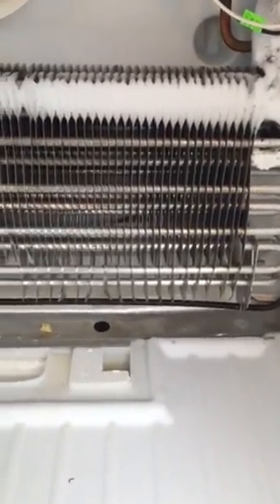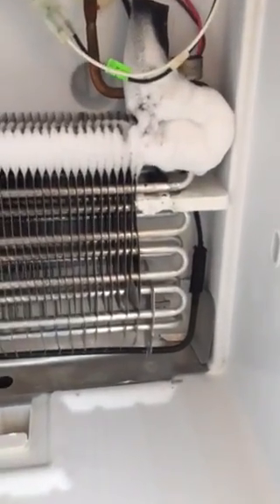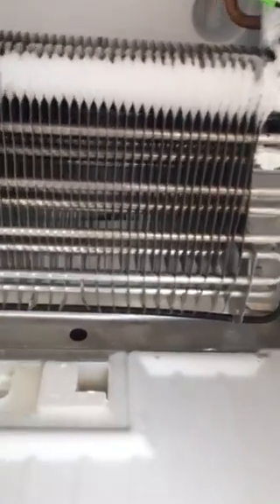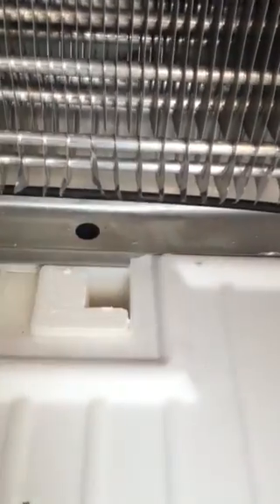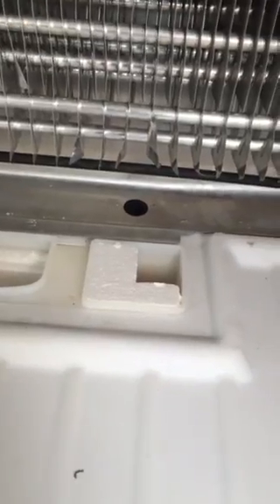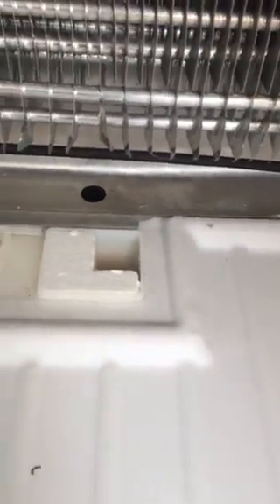Just a little tidbit that may help us going forward. Whenever you get a call that the fridge is dripping water into the refrigerator, we all know what to do about it — we use little spray bottles, spray that hole. This is usually all iced up right here. We get all that ice out, make sure you open that drain. That drain's got to be open. Water will run down when it is.